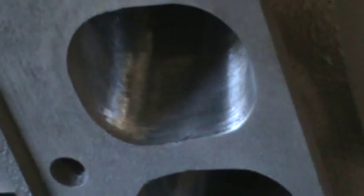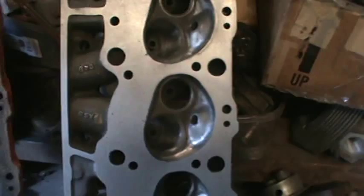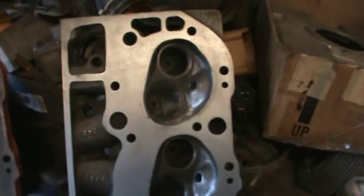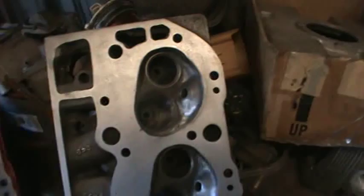Here's the street port on this head — a set of oval ports. That's the finish I leave the ports in: 80-grit. They're pretty clean, all the casting flash has been taken off, the bowls have been done, they're ported all the way through. They're not just funnel heads, as a couple of the YouTubers refer to some cylinder heads. There are some really good YouTube cylinder head guys, and I'll send you a link to some of them, Mark, because they have some really good tips on the type of cam you're going to run, the low-lift performance, and different tricks you can put on the valve seat angles that complement that type of cam.